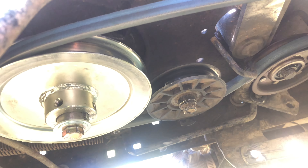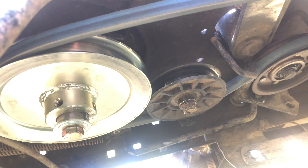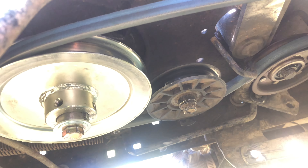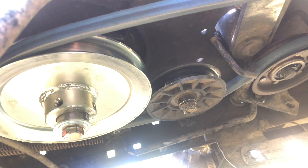I've been messing around with the belt system and finally got something to work. Not only does the air filter look a lot better, but I also redid the vent. Basically this is a grease fitting - I drilled a hole, screwed the grease fitting in, took out the internals, and ran a tiny piece of fuel line to a weed eater fuel filter. That way if anything goes up it would have to travel 90 degrees into the filter, and I cut a little bit out so it would still allow it to vent properly.